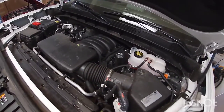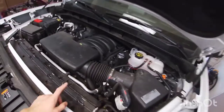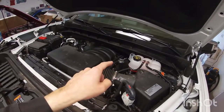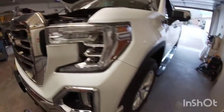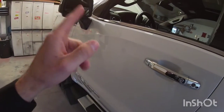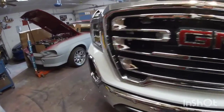One thing I did notice on this newer GMC truck — it takes 0W-20 on this 5.3 V8. It has to be full synthetic 0W-20, Dexos spec, which is different than the other ones. This vehicle was bought new and it's going to be about a year next month with only 2,195 miles. We're doing the first oil change because it's been a year — I'd say one year or 3,000 miles, whichever comes first.